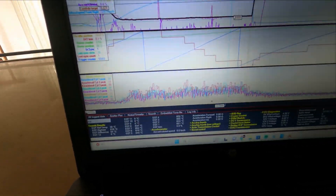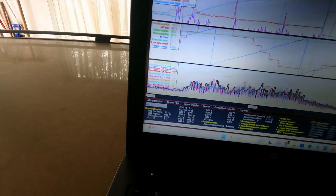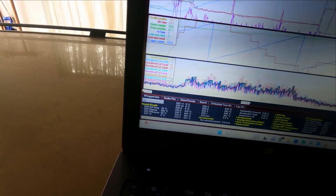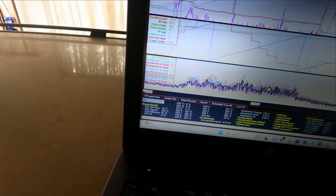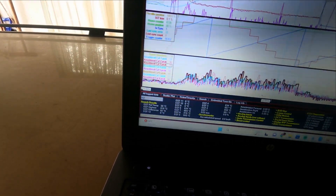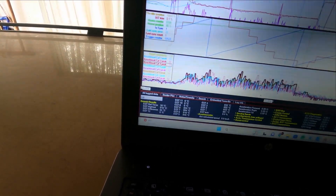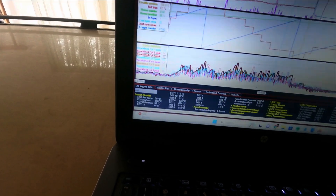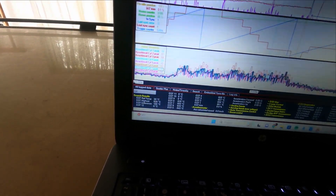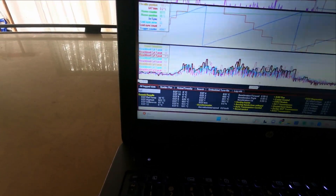The lambda values are pretty good, all spot on. The EGTs are up — last time I was running around 850 degrees but I pulled the timing out now, so the highest I had was 925 degrees. It goes down when the RPM goes up again. The highest EGT is cylinder 6, which is about 50 degrees higher, so I may have to trim that cylinder. I also need to check if the spark plugs are both igniting — maybe one of the coils is broken, I've had that before.